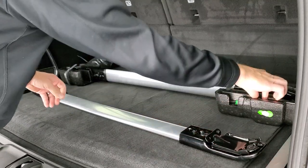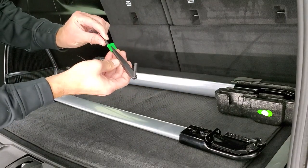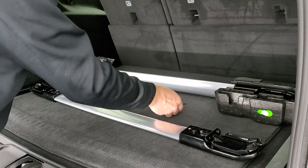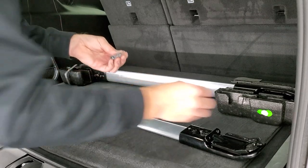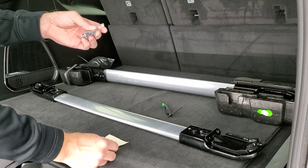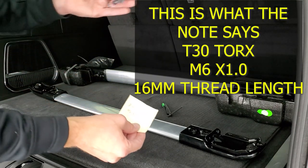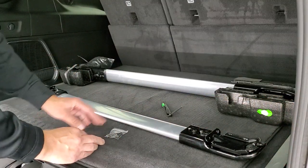They also give you a kit that includes this tool — it's a Torx 30 and it's also a torque wrench, so when you're tightening you can make sure you're not over-tightening and wrecking the screws. You also get eight screws. These are special screws: Torx 30 on the top and M6 by 1.0, which refers to the thread pitch and length. If you need to replace them, that's what you'll want to order.